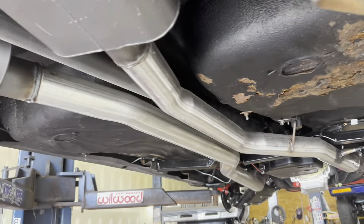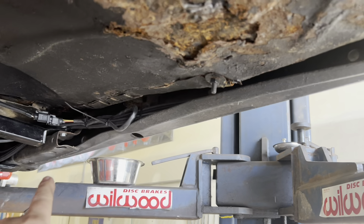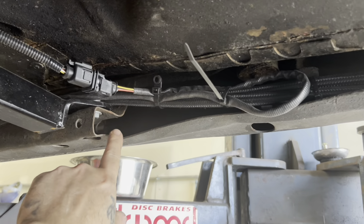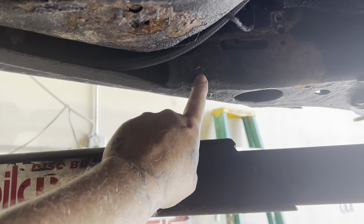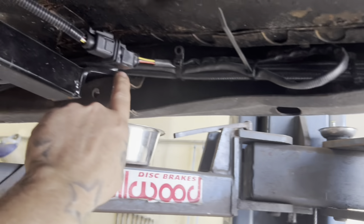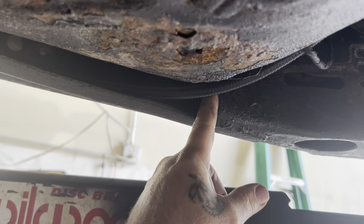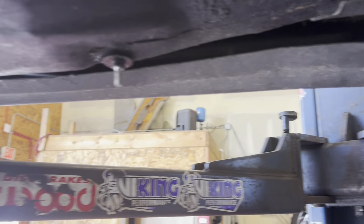I don't have tubing in stock but I ordered it. I gotta flex this frame down because it's all bent up — that's what happens when people jack shit up from the sides when they don't know where to jack. I went with inch-and-a-half tubing. I gotta bend this down so I can stick it in the side and get it welded in. I'll need to move the hose and stuff out of the way — they've got it zip-tied together. There's plenty of room to bend this frame down.